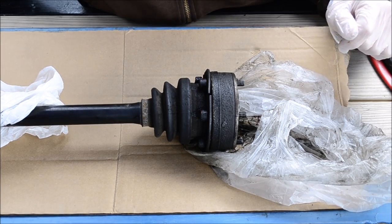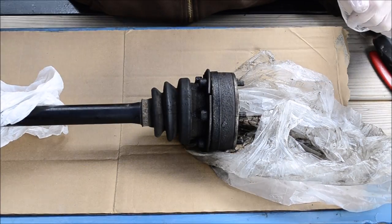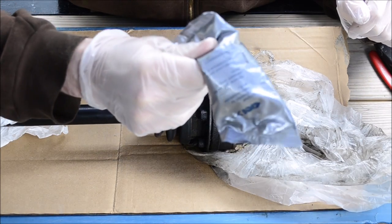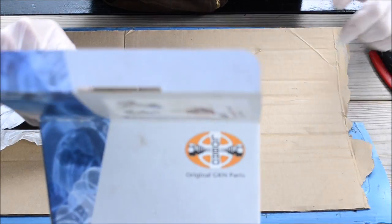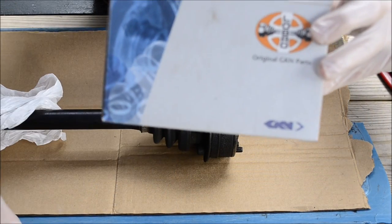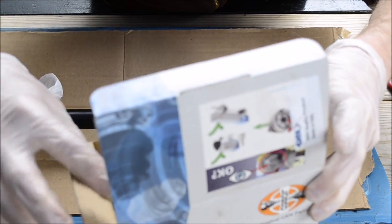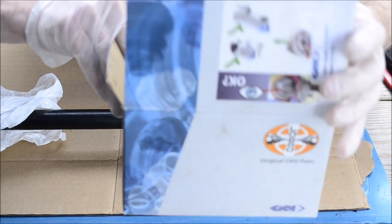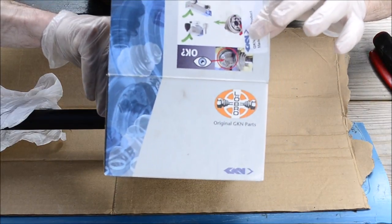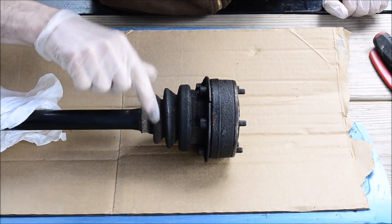One thing I gotta say is use as many gloves as you need to. Don't get this grease on your hands. It's really hard to get off. Just use the old box from the new boot as a place to put your parts if you need to put them somewhere. Also, I'll have links in the description as to where you can get new boots. And these boot kits come with the grease and new clamps and everything like that.